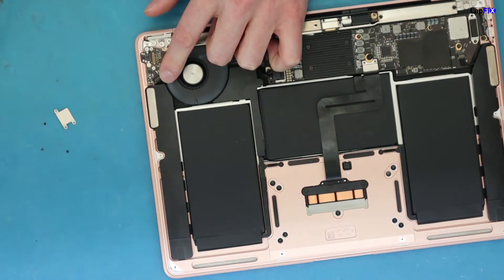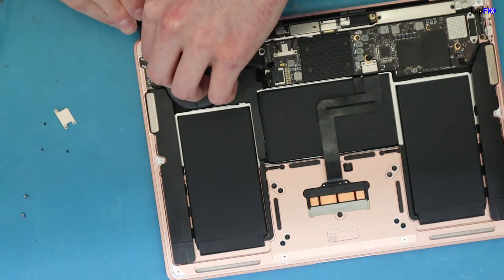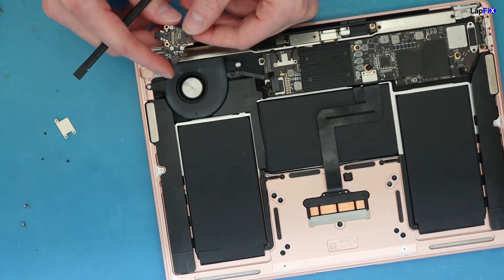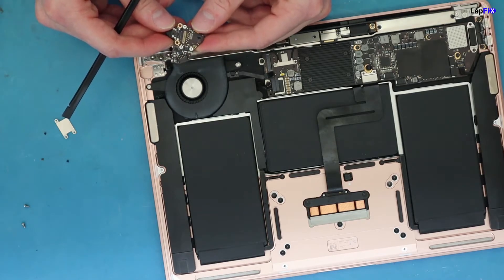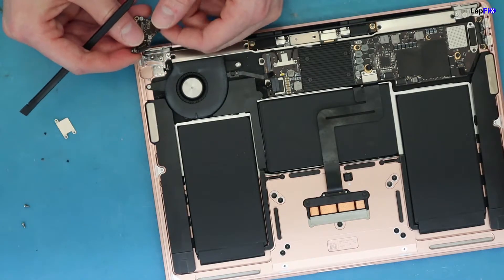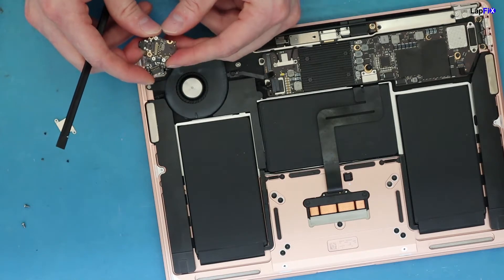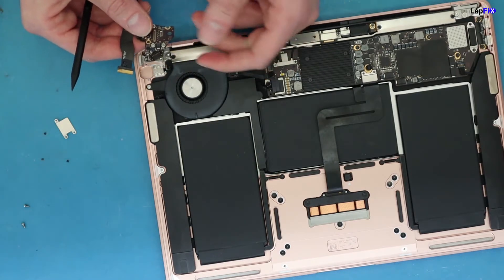There is also one at the bottom — that's a speaker connection. You can use a little flat edge to take it up. It's screwed down by two screws. Remove the board and it should come out like that. We want to swap this out. It's a pretty common issue, especially with liquid spills, because you can see all the components necessary for this to at least turn on and work. We see a lot of power issues with it because it does connect to the power switch — and then you also have the speaker connection and a separate cable to connect this to the motherboard. These are called audio jack boards. We do have them listed in our store — the link will be in the description. Usually if the connection is burnt, corroded, or anything like that, you're going to have a lot of problems, and most of the time you have to replace the board.